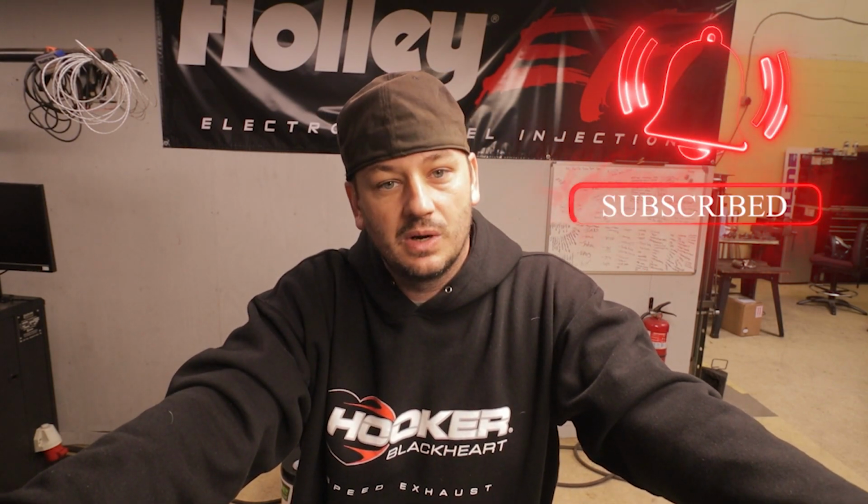So anyways, this is using dual solenoids and a dome pressure sensor, but it's using manifold pressure as a control source rather than CO2. This is the first car I've set up that way with Holley, and I don't know if maybe there's something else going on with this car or if that's the reason why, but all of the PID settings were just insanely different than normal. So I ate up a bunch of time playing with that, and then of course I got a little bit picky and spent probably more time than I should have trying to sort that out and just tinkering and experimenting.